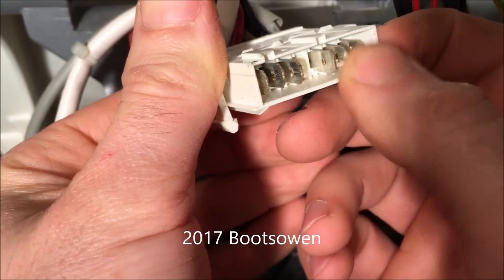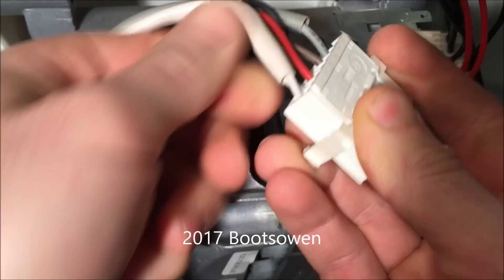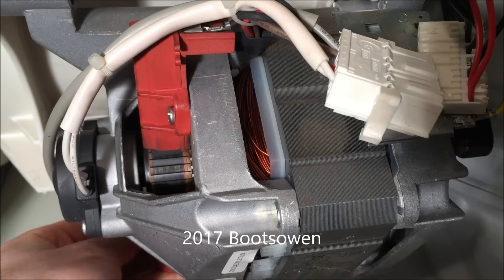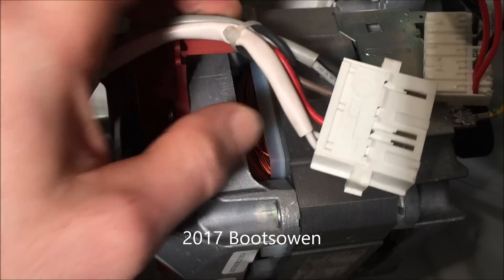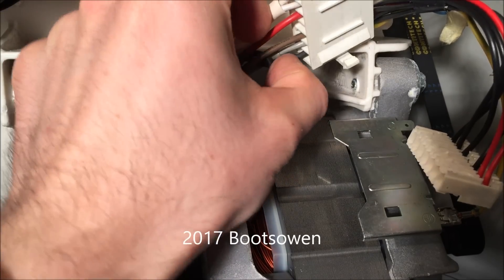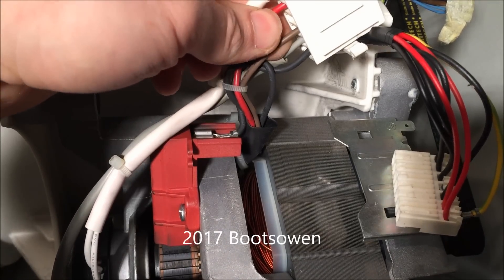In here we've got six tabs which makes life really easy. Two of them are white cables, and the white cables go to the tacho on the end of the motor. Down at the bottom, one of the brushes goes to this grey tube — the grey tube has a grey cable inside it, so that's brush one. Brush number two is this black cable here.